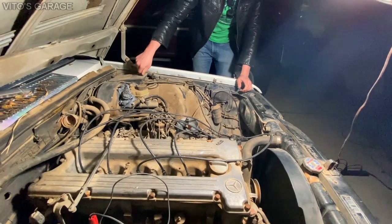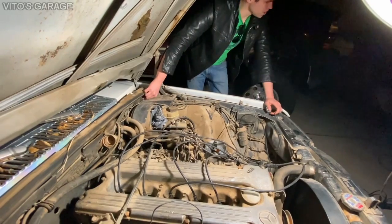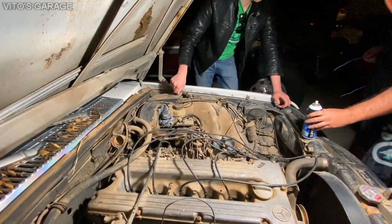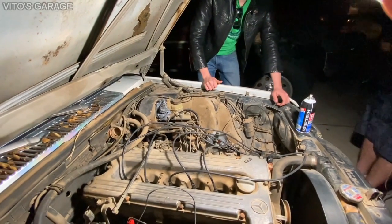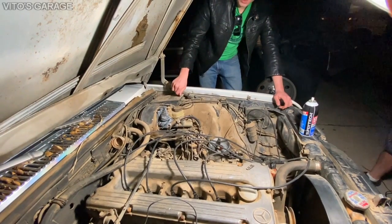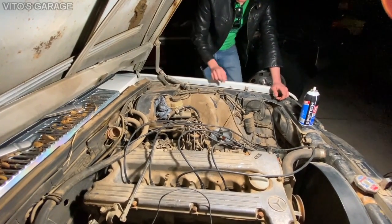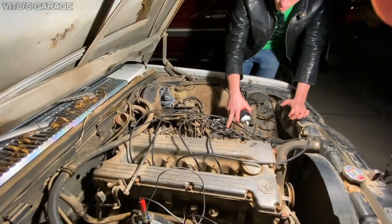I wonder how the fuel pump is controlled on this, because we might be able to just jump a couple contacts. Maybe the pump is not that bad. Also, the tank was really nasty in there, so I disconnected it completely from the tank. Gotcha. And the rest drained out, so the lines aren't even hooked up. Makes sense. That's why I went that route. Maybe this will work better. Let's see if it has enough juice right now.